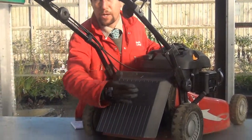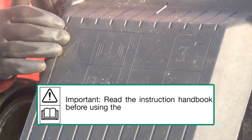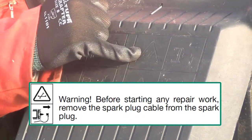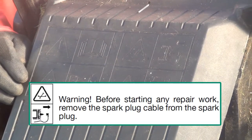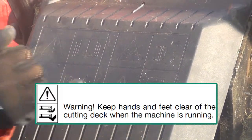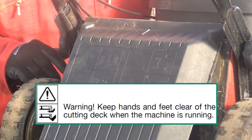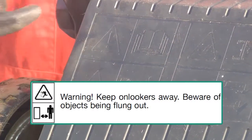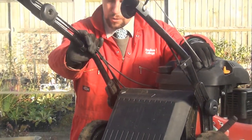On the back are also all the safety symbols in relation to this mower. We've got the hazard symbol — be aware of what's going on. The open book — read the manual. Then two symbols read in parallel: a triangle with two spanners indicating maintenance, and an engine with the HT lead being removed — that means remove the HT lead whenever you do maintenance. There's also a hazard symbol showing fingers and toes being chopped off because of the sharp blade underneath, so never put your fingers under the casing when the machine is working. There's a picture of a person with bits flying around — beware of flying debris — and a warning about operating near buildings, as stones can fly.